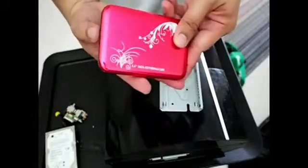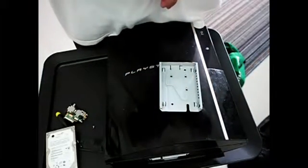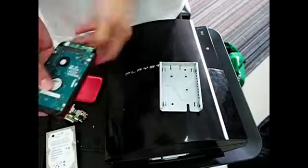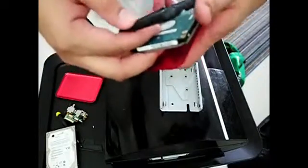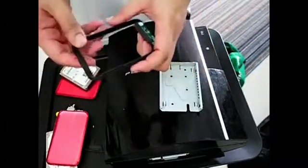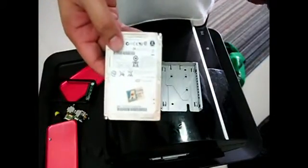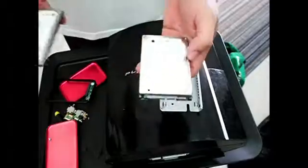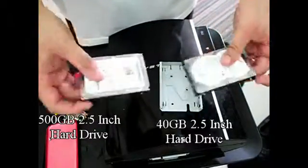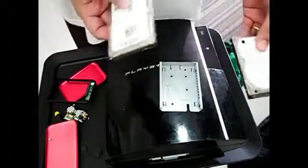This is my portable hard drive — I actually recycled this from my old laptop. There you have it: my 500-gigabyte portable hard drive. On my right is the portable hard drive from my old laptop, and on my left is the PlayStation 3's 40-gigabyte hard drive. You can see the similarities — they're exactly the same. The screws on the side to hold the drive in the bay are also the same. There's really nothing special about a PS3 hard drive, and this goes the same for any PS3: PS3 Slim, PS3 Super Slim.